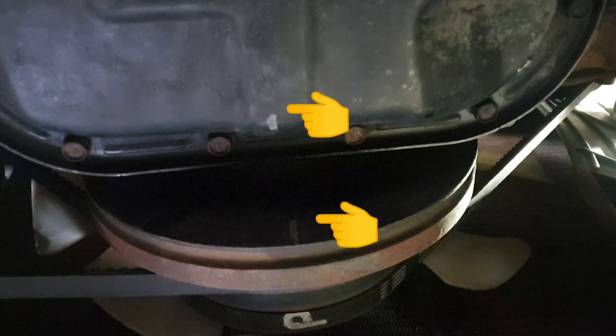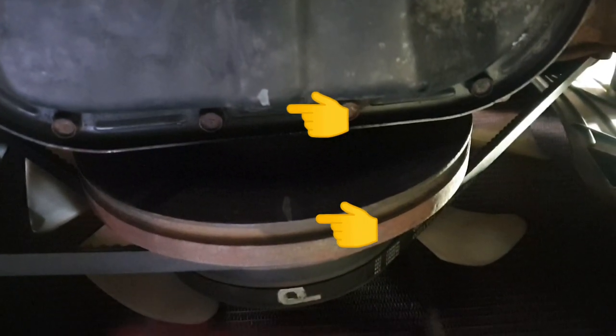What I've done before I turned it over 360 degrees again — I just put a mark on the harmonic balancer and then onto the sump. So while I'm turning it over, it makes it easier than jumping up and down.